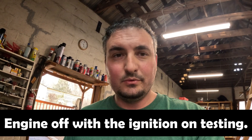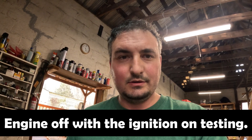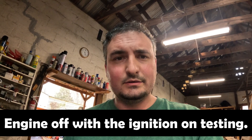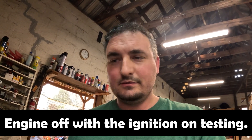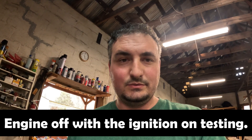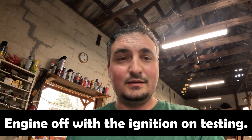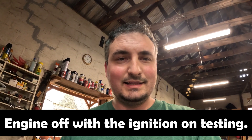Just me playing with the trans brake and these settings — I pretty much came up with this myself. Don't believe what you read online about it, because people say certain Hz won't work right. That's not true. It took 90 Hz to get this thing to flutter the valve. A lot of people say it won't do anything unless you hear it clicking like it does when you hit the trans brake — when it clicks, it's slamming the valve open and close.